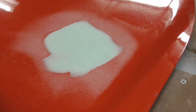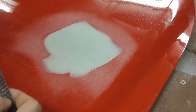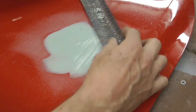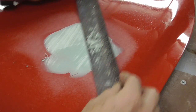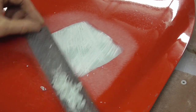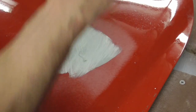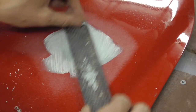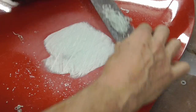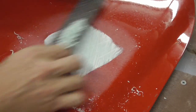After mixing and applying the filler, the next step is to use a cheese grater to take off the excess. That way you're not tempted to use a rougher sandpaper and end up putting deep scratches in the paint. Just take off the excess so that we can use 80 grit or even 100 grit on this filler and then we'll have a nice smooth unscratched surface to prime over. Once it hardens a little bit more, I'll be back to sand it.